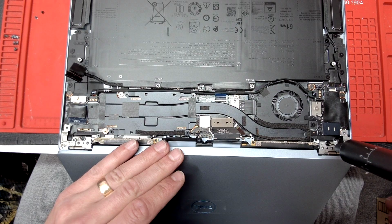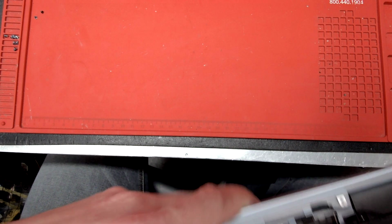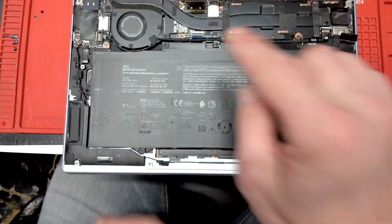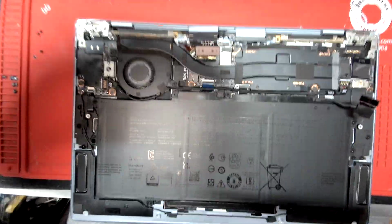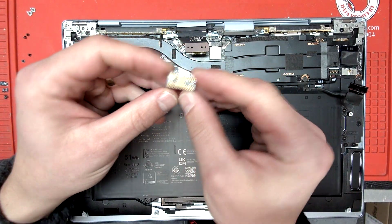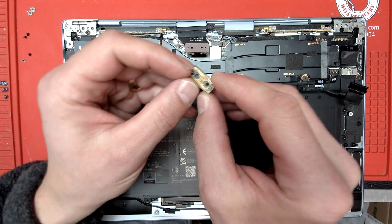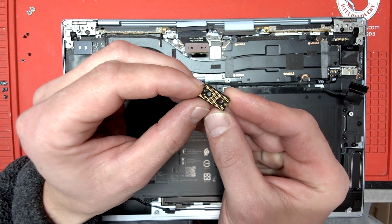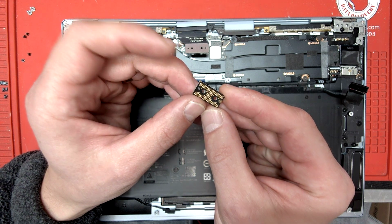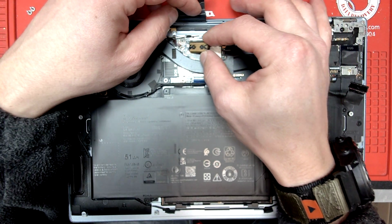And what we want to do, okay, after we put those two screws, we're going to close the screen again. And we want to test the screen, okay? So what we're going to do, I'm going to put this in case you misposition this one or you drop it off your hands or something like that. You see one of the corners? It has a little tab. I mean, it has a little metallic piece over there. So it shows you that that particular one has to be on the upper left corner.